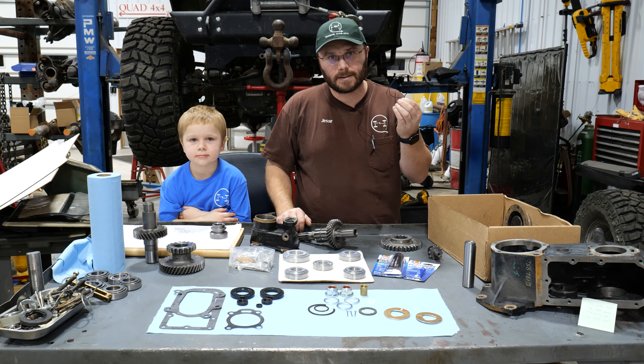The rear bearing retainer output bearing retainer shim is a specific thickness — I've got a couple of thicknesses. All the research I've done doesn't indicate you need to use multiple shims. I have found a specification for backlash somewhere, but basically you want to make sure that the shaft isn't tight when installed. You should be able to feel it move back and forth, so that when it warms up the bearings don't get tight and burn up on you.